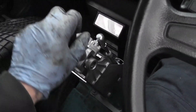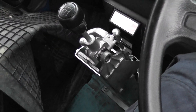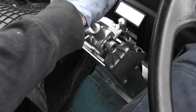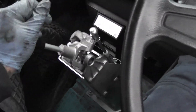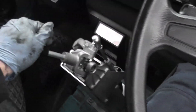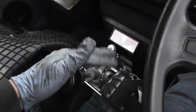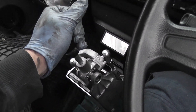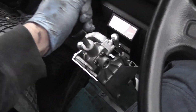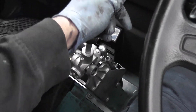That is beautiful. I've heard some people saying that the cable shift mechanism feels vague — that is not vague, I can assure you. I have driven modern cars with more vague gear shifts than that. It literally just slots into gear. First, second, third, fourth, fifth, reverse. And there is a lockout so that you can't go into reverse from fifth — that was there in the original Passat as well, so that still exists. If I'm in fifth and try to go into reverse, it stops you. You have to go back to neutral before you can go into reverse.